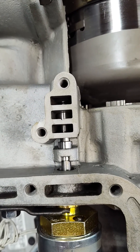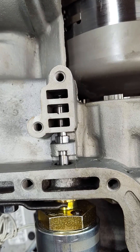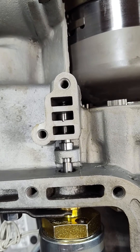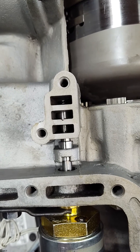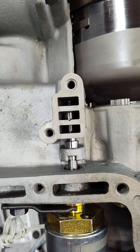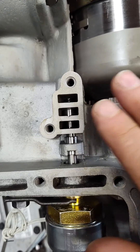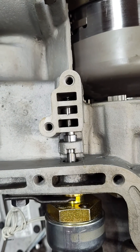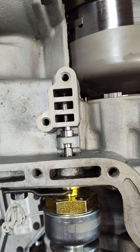Hopefully that helps you guys out. You need to understand this if you're going to install trans brakes — especially if you're a shop installing trans brakes in something other than a powerglide. This is a C6; it's a little bit different of an animal. Do all these checks before the valve body is in so you can see in there and watch what's going on. Okay, that's all I got — thanks for watching.